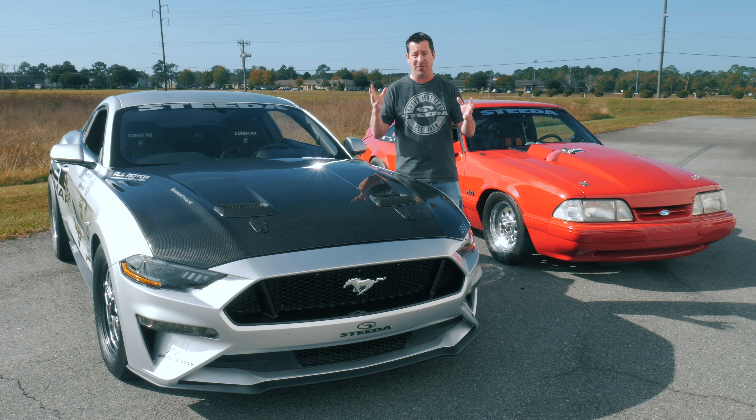The reason why you see skinny tires on these cars is less rolling resistance, less weight, a thinner tire, less contact patch — the quicker it's going to go down the track every single time. And just like we mentioned in the first modification, we like to jack the air pressure up 50 to 55 pounds on those front tires. Less rolling resistance means we're going to trip the beams a little quicker and get you that quicker elapsed time every single time.